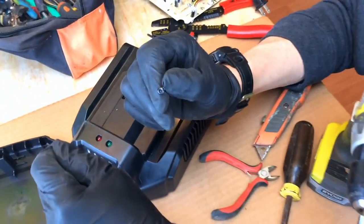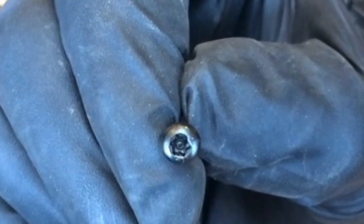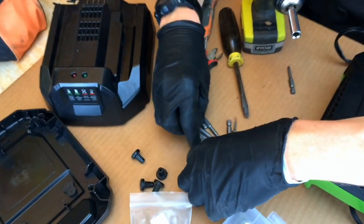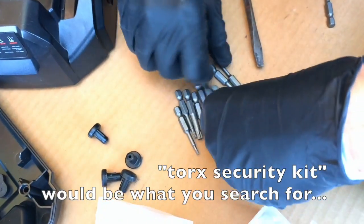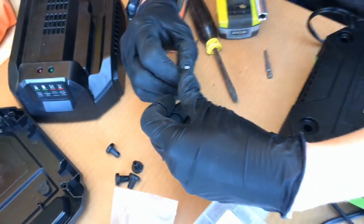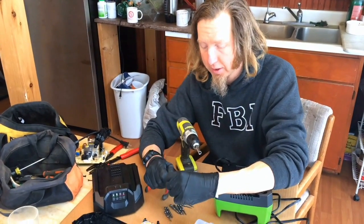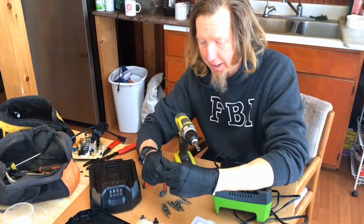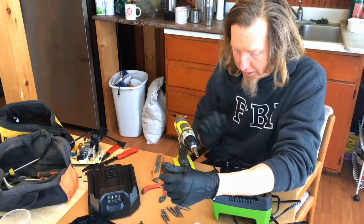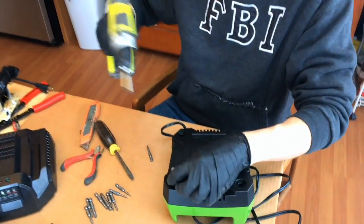It looks like maybe a T15 or T10, but you can see it has a little thing in the center that prevents you from using a normal Torx head. So what you have to do is look on eBay — I just buy a Torx security kit from China because they cost maybe $2, and you get a whole collection of Torx bits that all have the security bit. Any electronic tool kits you want to modify will almost always need this Torx bit, and they're different sizes for everything. You basically just put it in and see if it sticks and turns — if it does, that's the right bit.